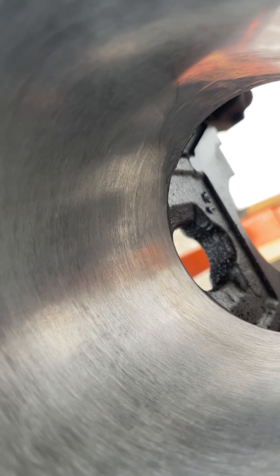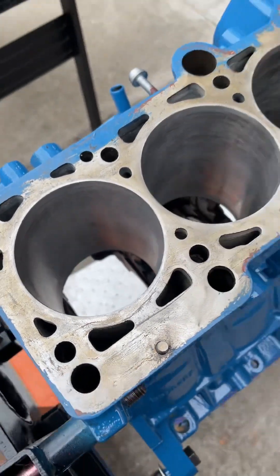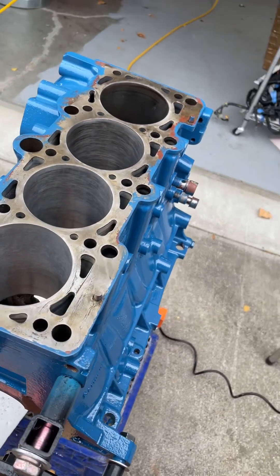You can see that's all nice and clean, and you can see the ring where the piston doesn't travel — a little bit and a little bit more — and of course it's pretty dark there. You're getting the cylinder honed all the way down, but you don't want to go so far down that you hit the journal.